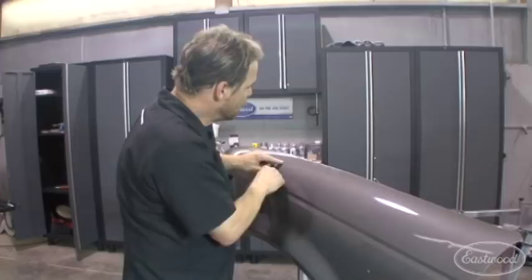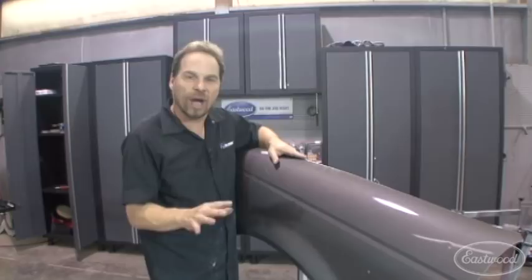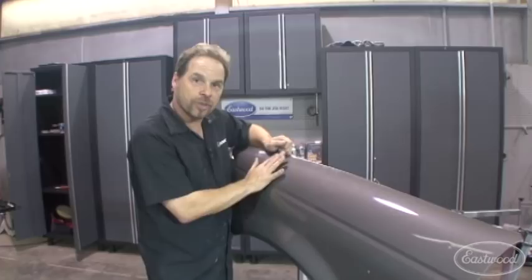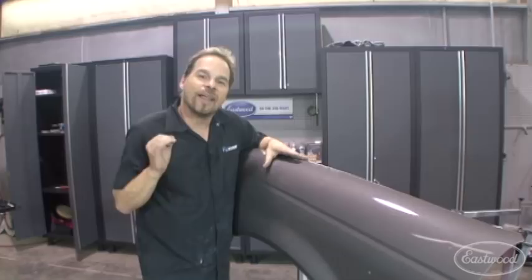Right there is our fixed rock chip. Is it perfect? No, it's not — but that's okay. This is not designed to be a permanent repair. If your color matches, yes it can be. But if it doesn't, it's designed to get you through the show season and keep you driving without worrying about that rock chip. You're not going to lose points at a show. It also gets you ready for a complete respray without having to feather out or fill in with filler, because you've now got a base coat clear coat repair leveled into the surface that you can simply prep and respray in the winter months. There's more paint in the can — and you can get that paint from the Eastwood Company. This is Kevin's Corner; we'll talk to you next time.